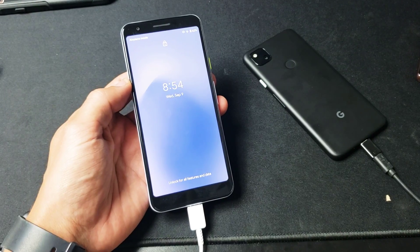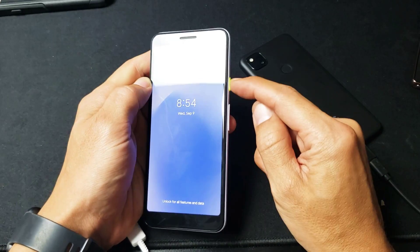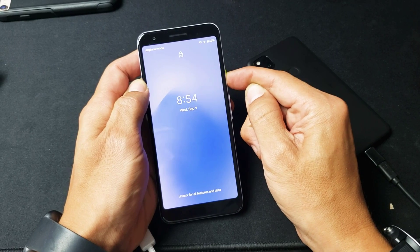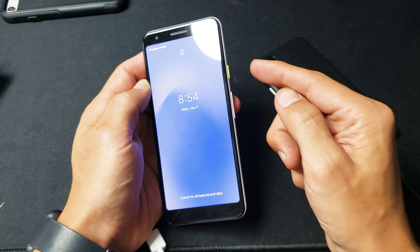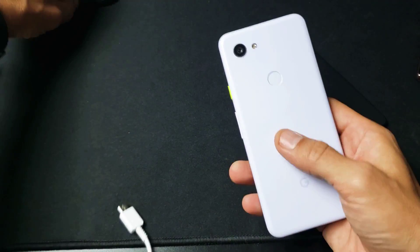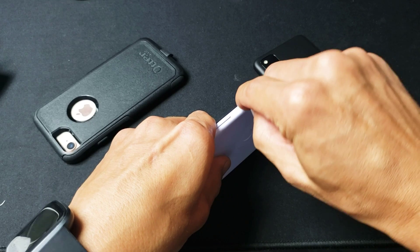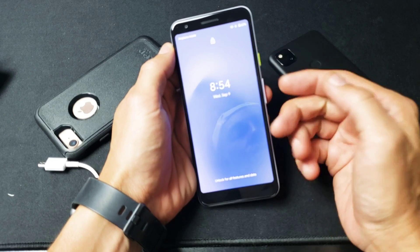Step number one: the power button is right here. What I want you to do is press it in and out a whole bunch of times — go crazy with it. Because what happens is it could be stuck or jammed — could have got soda or hand lotion in there — and that could be the reason your phone is constantly rebooting. You can even put the power button against a book and just keep pressing it.